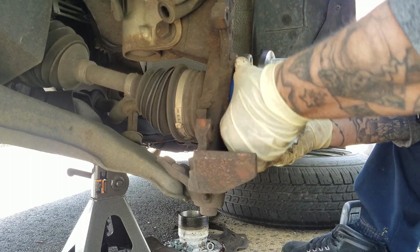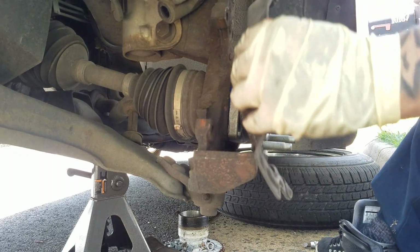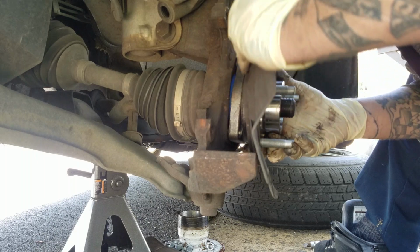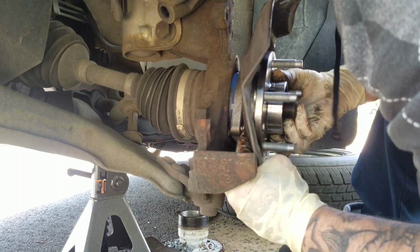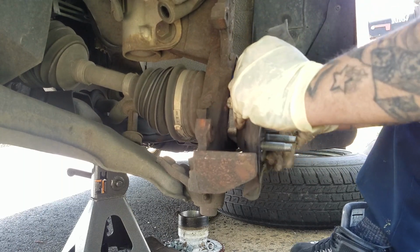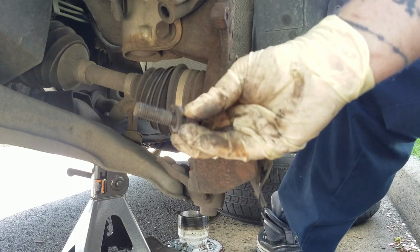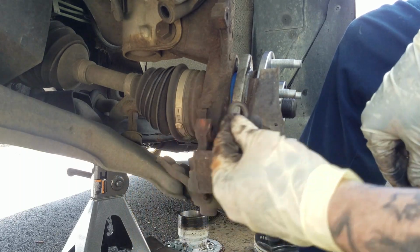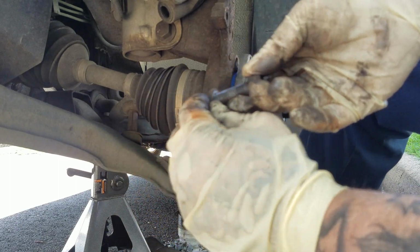There you go. So line up the hose. Gotta put the dust shield back on. It's gonna be a problem because it's a little bit bigger. Right. There you go. So, just so you guys know, these screws, obviously this washer is not going to go through the access hole. So what I do is I slide the bolt first, and then from behind it I slide the washer.